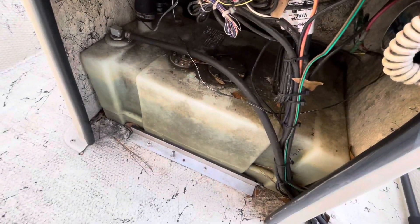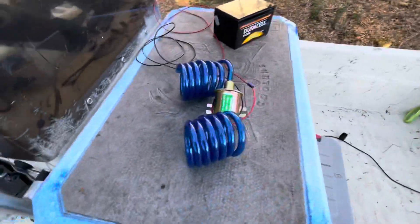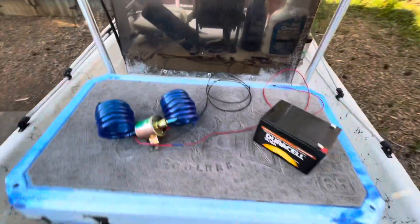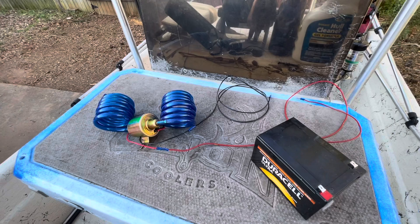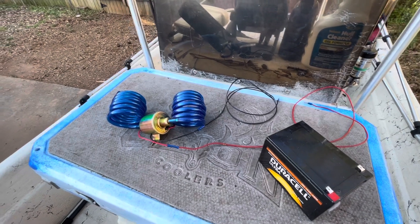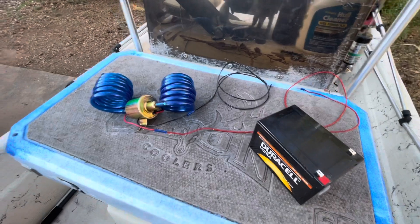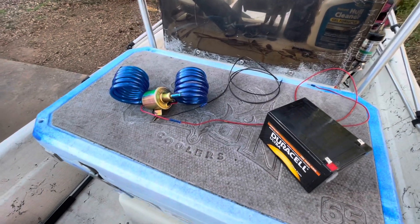Basically what I'm trying to do is I let this fuel sit in my boat for about four months and it's no longer good. The boat engine is not turning over, so I need to remove that fuel from the tank, replace it with good fuel, and then check the fuel lines, spark plugs, and compression in the engine. If it's a compression issue, that's a much bigger problem.